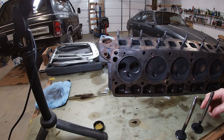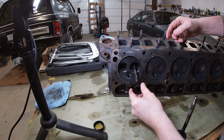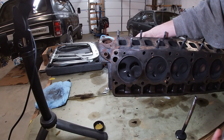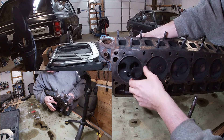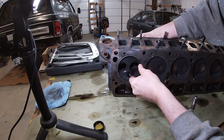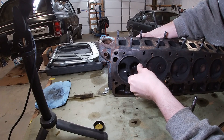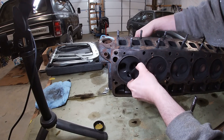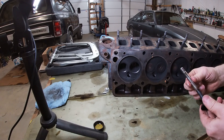I'm going to check the valve guides - nothing groundbreaking here, just something basic. It's got a little bit of oil. I coat it real quick, put it in there. I'll put my finger over the valve guide over there so it seals. I'm pulling it fairly good and it pulls it back in - that's what you want to see. The other thing I like to do is just see how much slop is in there. There should be a little bit because it needs a little bit of oil coating. I don't feel hardly any slop in there - that's what I like to see. So that valve, even though it's from 1977, it's still good.